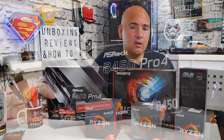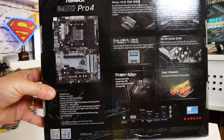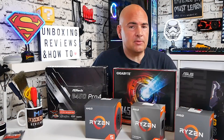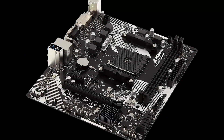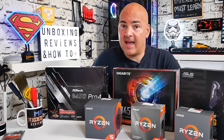If you're buying a moderate CPU or APU and want to overclock it to increase your investment, the B450 chipset is where you want to look. But this is where it gets complicated — the chipset itself is generally universal, but the way it's implemented on motherboards isn't. Some very budget-end B450s, such as the ASRock B450 HDV version 4, are limited with their VRMs and won't overclock particularly well. They are really suited for Ryzen 3 and Ryzen 5 processors at most, and results will vary for higher-end chips.